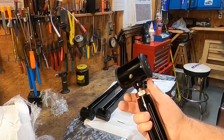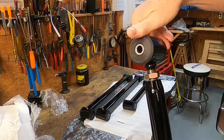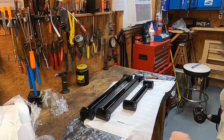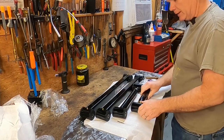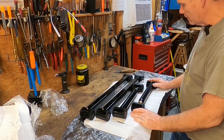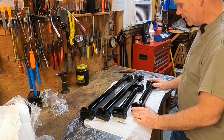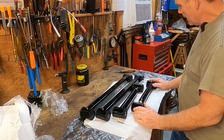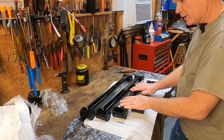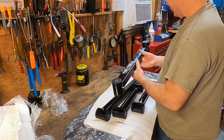Here's your adjustability — your locking nut right there. And that looks really, really simple. What we would do is take measurements of the upper arms and then kind of eyeball it and get these as best we could to the same length. Then we would start our tuning procedure. I think we'll utilize the spreadsheet from the previous video and probably knock three or four degrees of pinion angle out of the rear end with these upper arms after we get them installed. That is just so pretty.